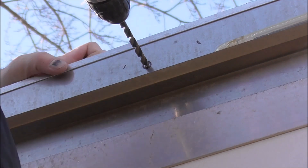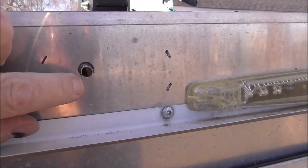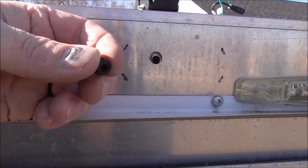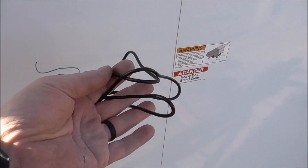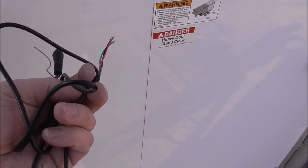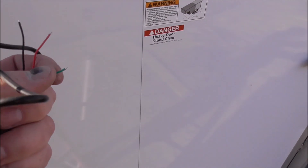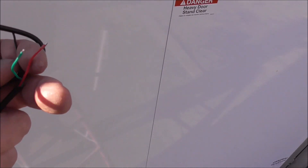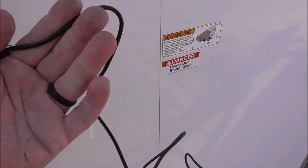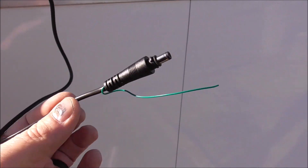Now I'm going to drill it. That looks good out here — no burrs anywhere. I'll go inside just to make sure there are no burrs there, then I can put the grommet in so the cable doesn't get damaged. Got a little bit of a burr on the inside, so we'll get rid of that. This is the wire that comes with the kit — this is the other half that plugs into the camera. The hard wires are green, which is the trigger wire; if you wanted to put your vehicle in reverse and have the camera come on, you'd hook this up to the reverse lights of the trailer. Red is power and black is ground. Now that we've got the grommet in, we can feed this through from the outside in and push all the slack inside the trailer, keeping very little outside — because it's going to get tucked inside that camera housing.